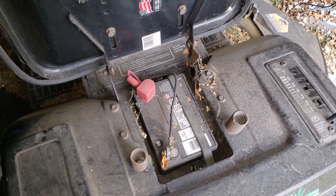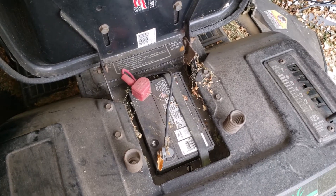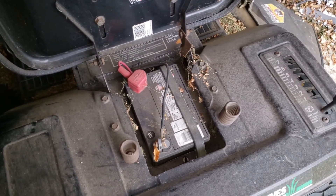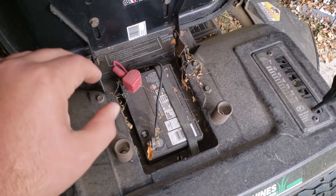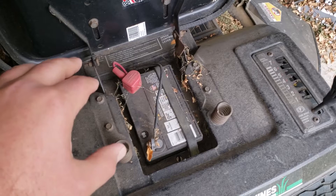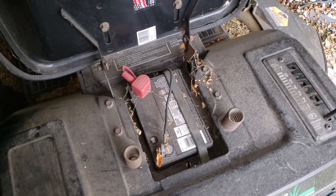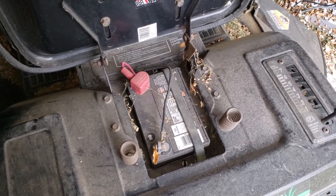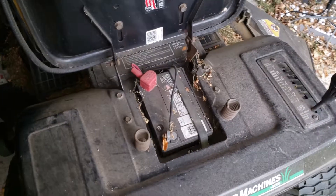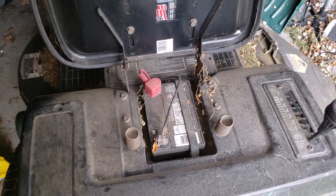But if you've noticed that maybe your lights are a little dim or it's a little tough to start, your battery might be getting weak. If you want to try and help your battery last another season, definitely go ahead and remove it and put it on a trickle charger, that way it's maintained all the way through the winter — maybe down in the basement or a room that's safe to charge your battery in. That way the battery stays nice and toasty warm all the way through winter and is ready to go come spring. Hope you guys enjoyed the video, feel free to like and subscribe and I'll check you next time.